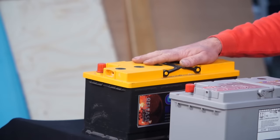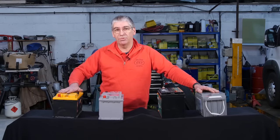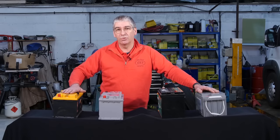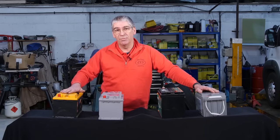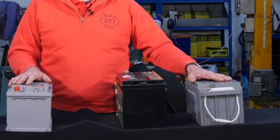The lead acid batteries are ideal if you're camping on hook-up sites mostly, because of the shallower 50% discharge rate available. You won't harm them because you'll be on hook-up most of the time. They will supply the power you need for short periods — the odd night or two — without doing them any harm. If you're going to be camping off-grid, as it's often referred to these days, then the AGM and the gel batteries are better suited to it.